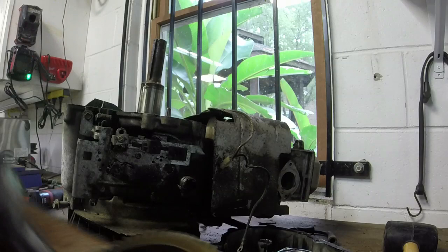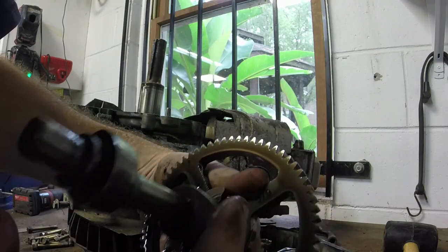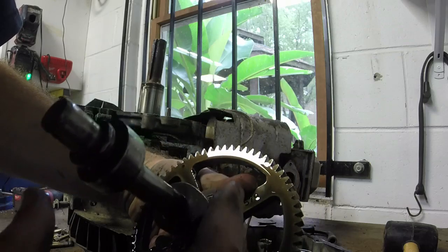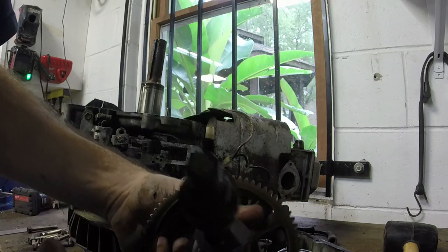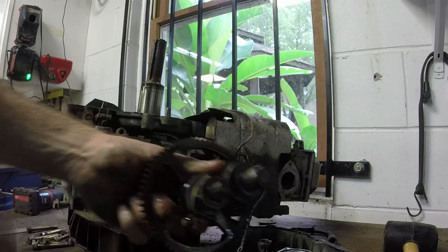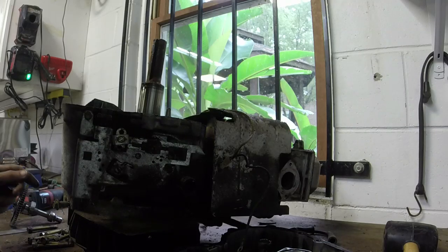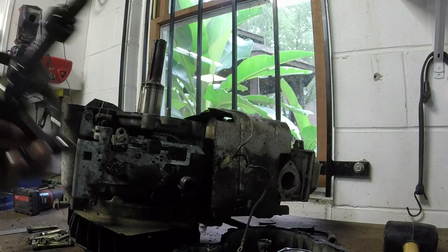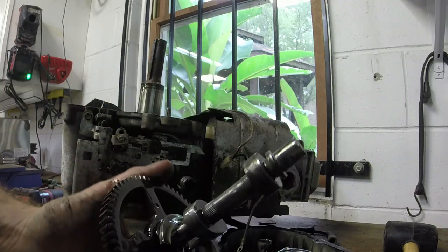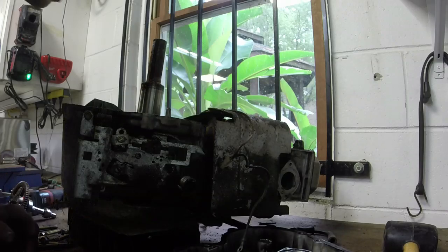So you see the intake lobe down here. I believe that's the intake on the bottom. It is. See, it looked like this. Look at the exhaust one. It is straight up just a flat circle. So, good news is I don't have to fetch a compression release because that's there already. So there shouldn't be anything crazy in the mower.